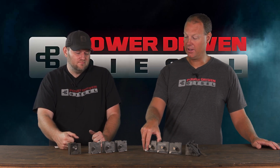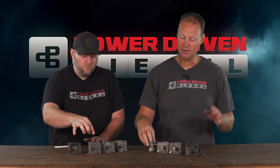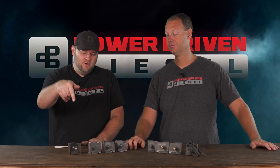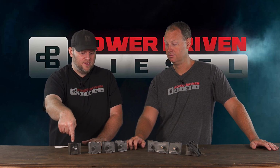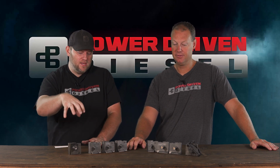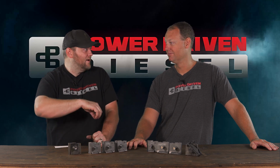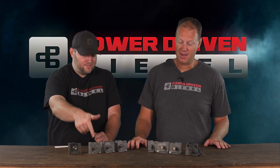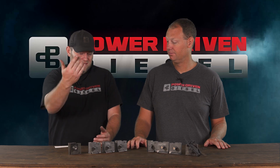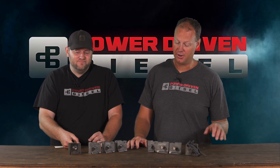I want to talk about the oiling upgrades on the pins. Let's show these pins real quick right here, guys. Well, before we go off the material, really quick, the final problem I've seen on the factory ones: because they're so soft, it's common to have the thread strip that holds the factory valve cover on. You're not going to strip these threads. I guarantee you will break off the bolt before you strip these threads, because it's hard, heat treated, and it's a better material. It's a solid upgrade for sure.